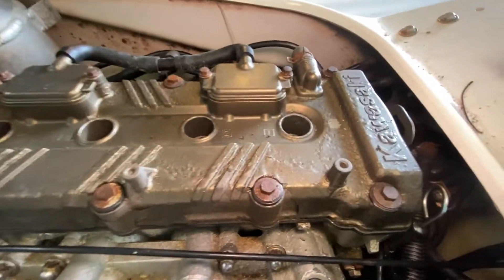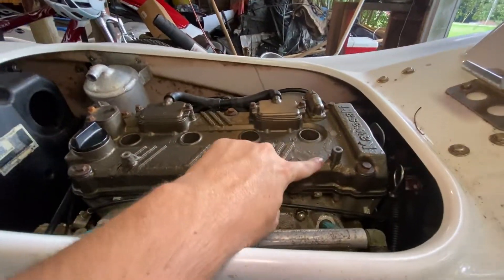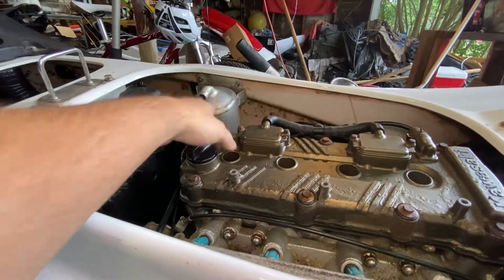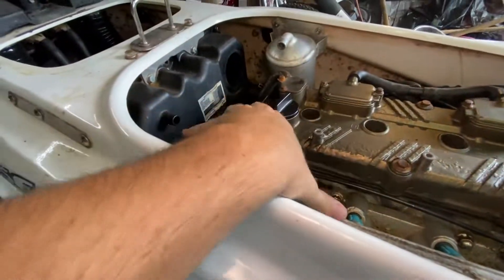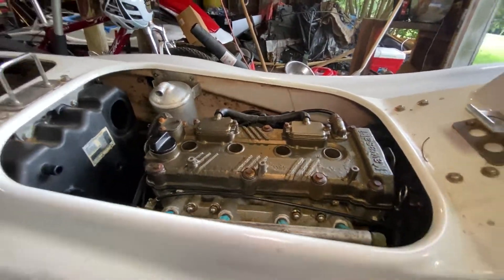Take a look at how crusty that is. We'll get some glamour shots of this and then let's start taking it apart. What we'll start with is popping the valve cover bolts off, taking all these lines off, taking our intake out, all our canisters. Then we'll take the exhaust off and then we can pop the head off.